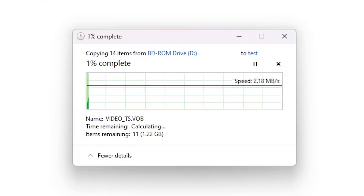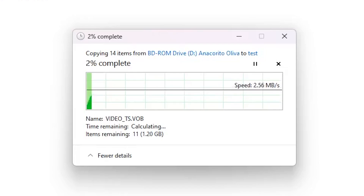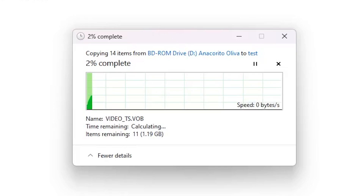DVDs are just an aluminium layer sandwiched between two polycarbonate layers, and the layer where the light has to go through is all scratched up. They use a red laser and effectively they're encoded with mirrors - the red laser either hits and gets reflected back, which could be a one, or it scatters and that's a zero. The problem is it's so badly scratched it can't get through. They do have ECC - about 10 to 20 percent - so the DVD can continue to operate with some scratches and errors, but this one's just beyond that and it just stops.